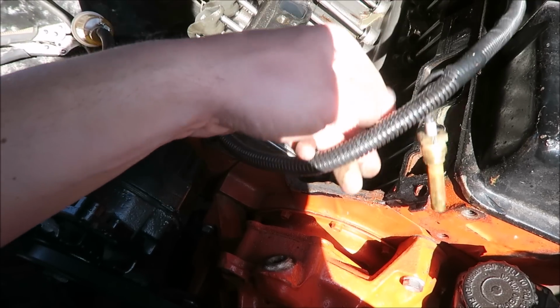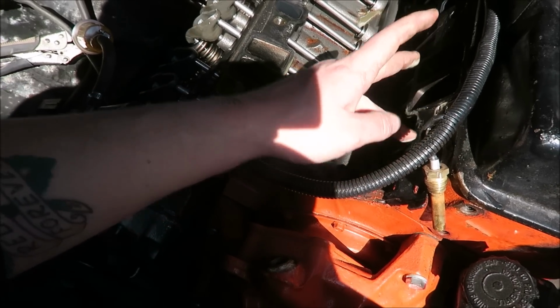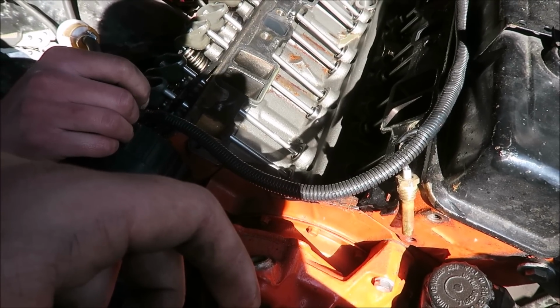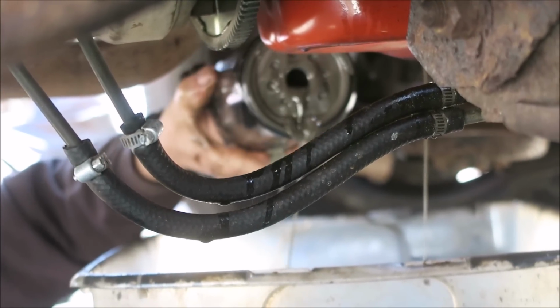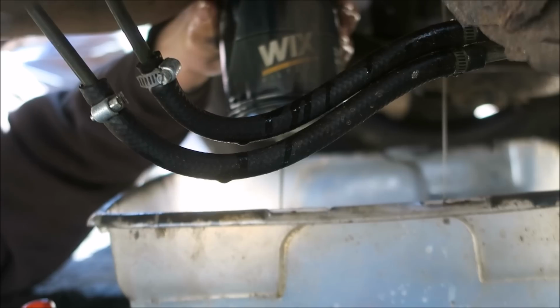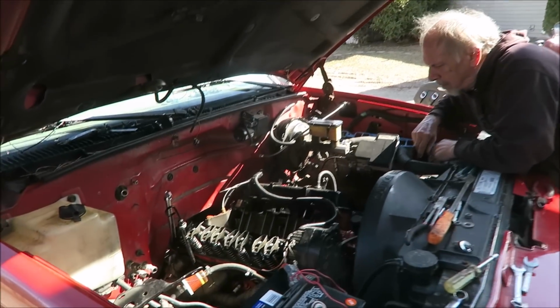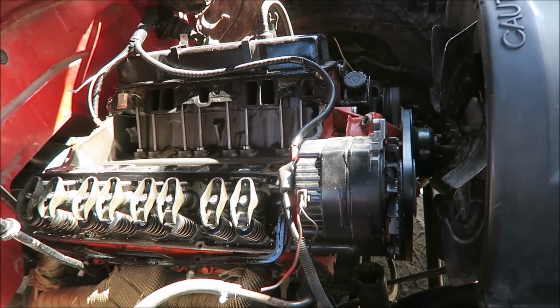Well, the gasket looks like it's intact there, which is weird. Ripped right there. I think that's from pulling it off, though. Boy, it's a funny shade of oil. Let me drain the oil filter. Yeah, I'm hoping the battery doesn't die first. Oof. That looks like water. Yeah. I'm sure the bearings are fine. Well, the gaskets look alright for the most part, where they tore when I pulled it off. That's all that looks like to me. They stuck to the intake when pulling the intake off.